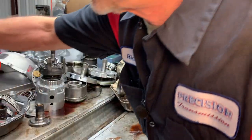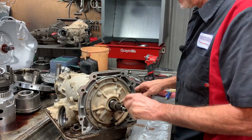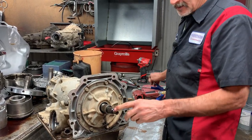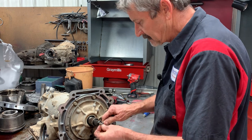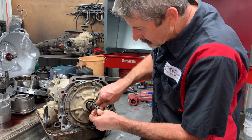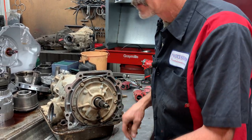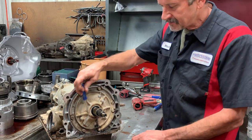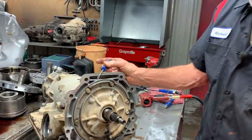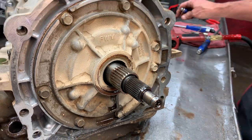It's got the thin bell housing and thin converter - got the early design input shaft, same as the early 700 4L60. Of course we have a lock-up O-ring that shrunk down into the groove. It's soft but it shrunk down into the groove. We have no steel retainer - you notice that? There's no steel retainer on there at all. It will have one when it goes back on.